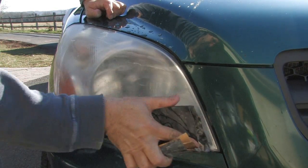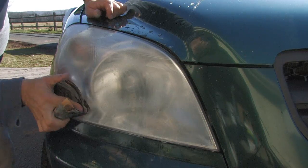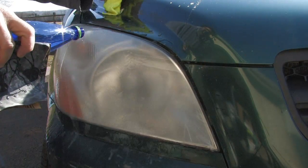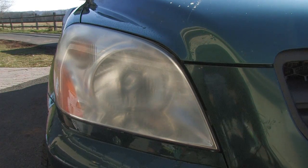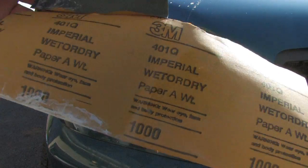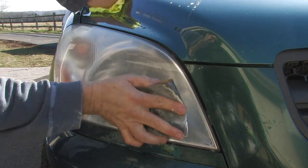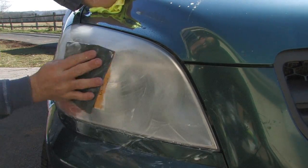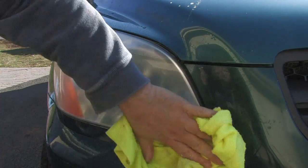So we're going progressively finer and finer, starting with a 600 grit. Now we're on the 800. We'll rinse this off in a minute or so, and we'll switch to the 1000. A little less foggy, but you're still seeing some scratches. We're going to switch to the 1000 now. All right, we're just about done with the 1000 grit. We're going to give it a wipe down and a rinse and another wipe,